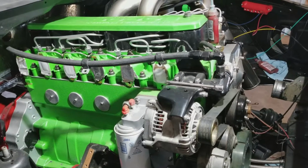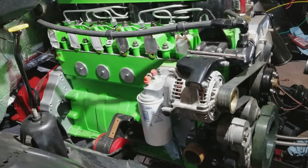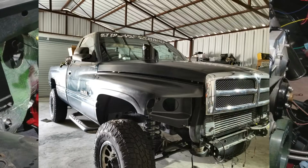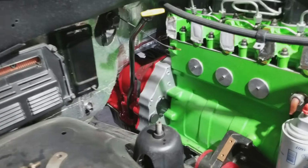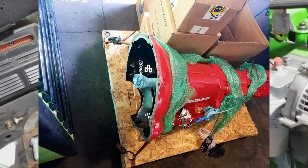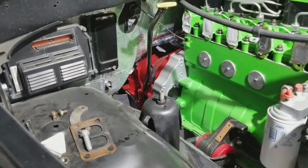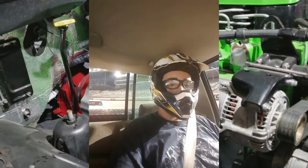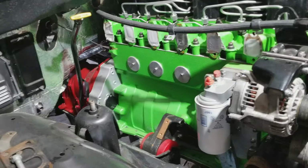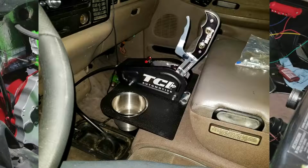So phase 1 of this truck is going to be just get it back up and running. We probably are going to get rid of the 362. We're going to go to a 364.5, which is what Power Driven Diesel, who built the transmission, recommended. That is a 1500 horse transmission, quad disc torque converter, fat input shaft. We are going to probably end up changing the transfer case and rear axle to a Dana 80 and a 241 DHD transfer case. Right now we've got the 231 transfer case with the Dana 70 rear axle, which will be all right with the initial setup, getting everything running.